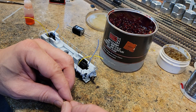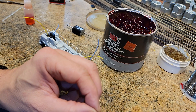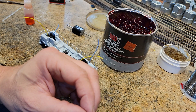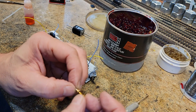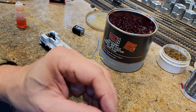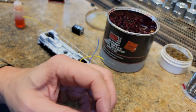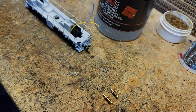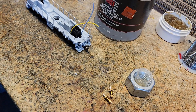That one's good to go. Now on this side we've got to be really careful — we don't want oil to inhibit the friction of our hose. I'm just going to put a tiny dot on the thrust washer like that. Then pull this guy just a little bit and get it onto the side so that this area here remains nice and clear. I can clear it with some acetone — we've got to use a natural brush. Take just a tiny bit of acetone and wipe a little bit. That'll make sure our hose will be nice and secure, because that's a short little shaft.